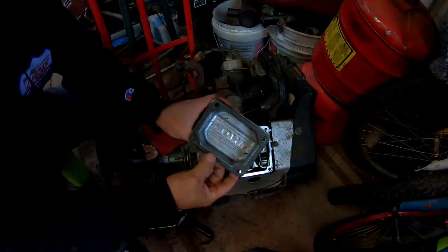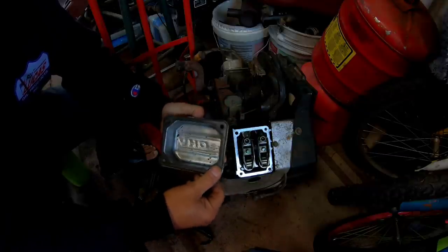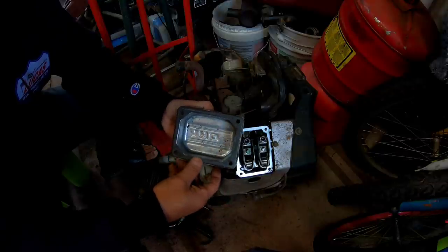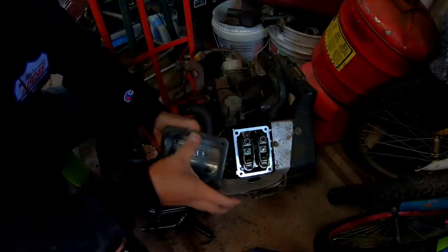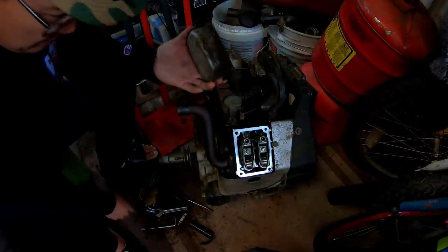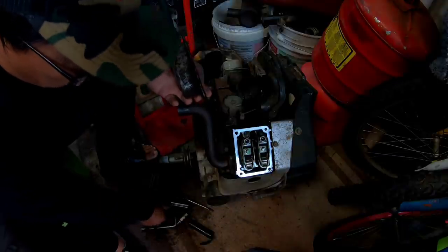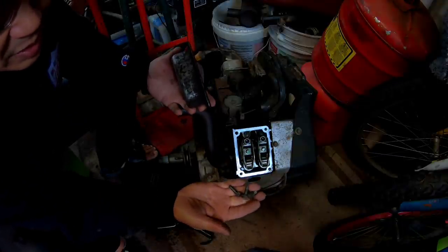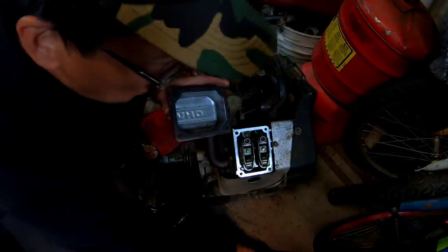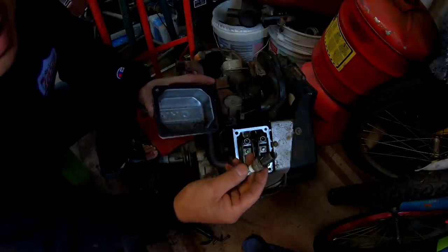See? The gasket is already on here. No tears. It's smooth. No erosion from it, you know? Nice, clean contact. So I'm going to clean the inner part of it, too, and apparently, I only have 3 of these bolts to secure it on there. These look like 3/8, not hard to find, so I'll find a 4th and we'll be able to put this baby on.